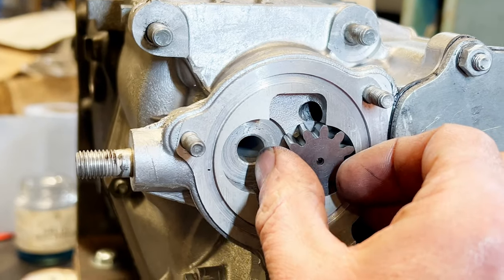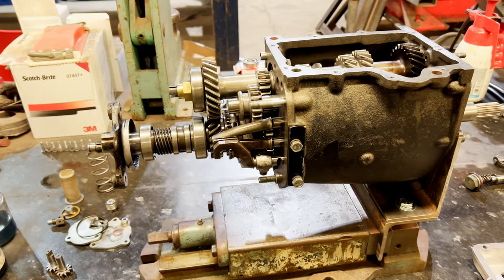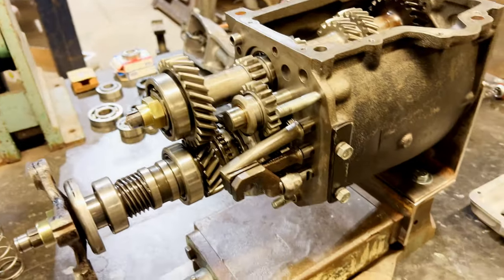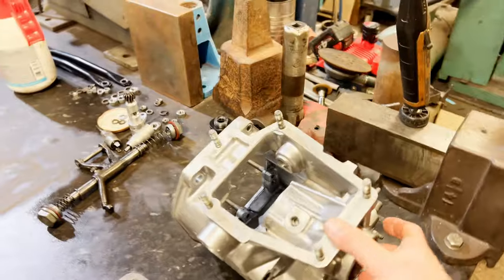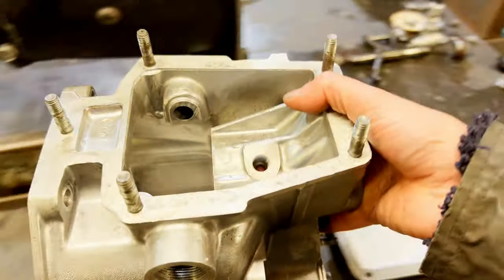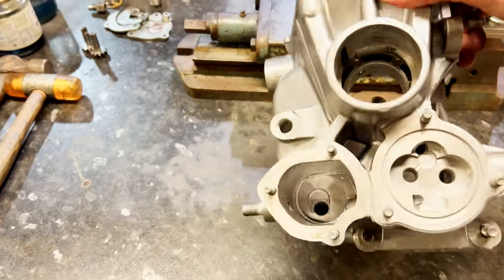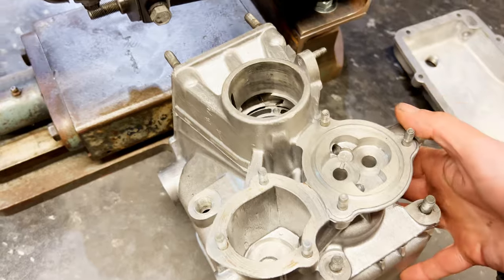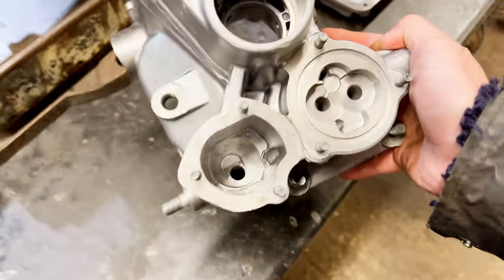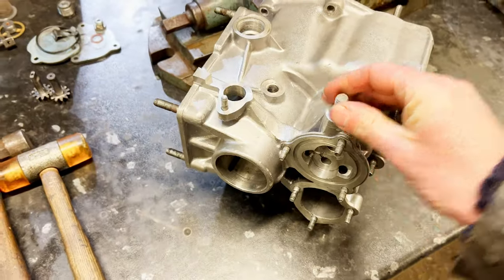We're going back together, but before I put the end casing on, let's have a look at it and see what it's all about. This is the fabled fifth gear with the oil pump. I don't know many gearboxes that have oil pumps on them other than some race car things, and that's really to do with cooling of the oil - to circulate it. It's not normally to do with any pressure feed.